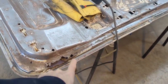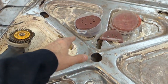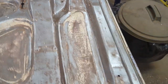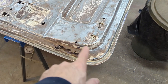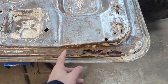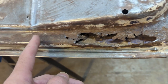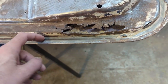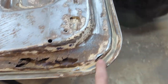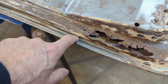Tackling this old trunk lid again. I'm going to start working on these spots. This paint here is hard to get off. So I'm going to keep picking away at sanding this paint off and getting it all cleaned up. The red oxide primer on this car is embedded right in the metal — man, that was good stuff. I'm going to start on this side and make a piece. I'm going to see how far I can get without cutting that open — that metal down in there looks really good. If I can get this piece cut out without disturbing this seam, I'll be happy. It's got a little drain spot there which was plugged with seam sealer, and that's probably why that rusted out. So I'm going to go back as far as I can without disturbing too much.